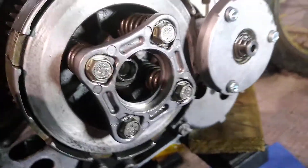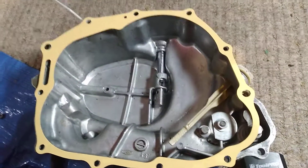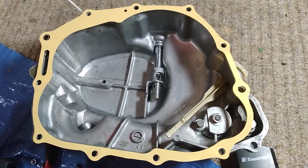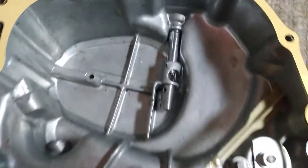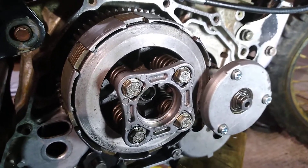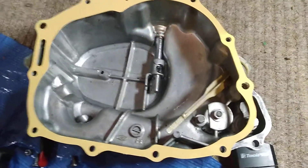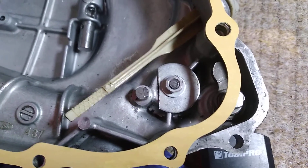So I may have to buy a new push rod — an actual push rod for an XR230. But the other option is changing this side cover out, because it's got the hole there for the kickstart that I'm not going to be using, for a CRF230 side cover, which I can buy for about $70 here in New Zealand. That one does have the hole in the centre, and it would line up nicely with my CRF230 push rod — I think that's going to be the best option. The next problem though is this gasket for the CRF230; everything lines up nicely except for this little extended piece of the housing.